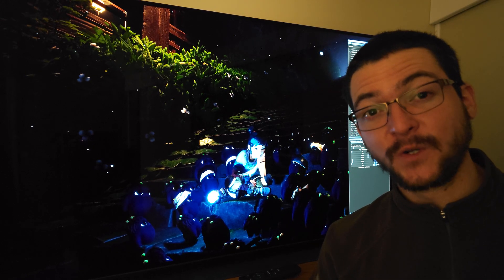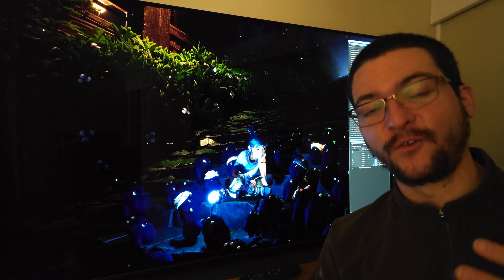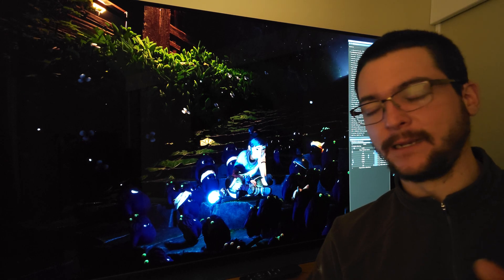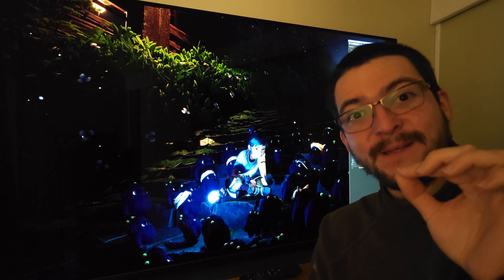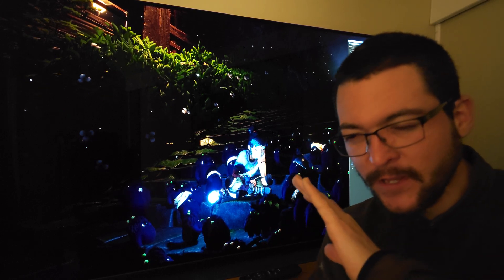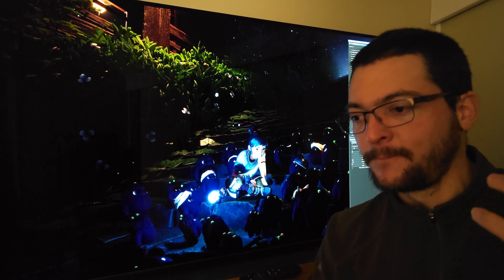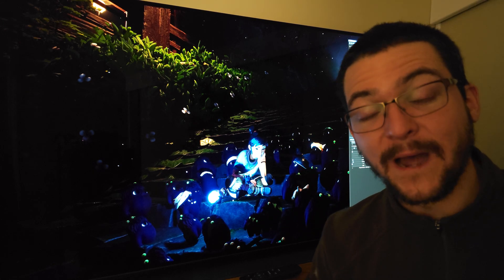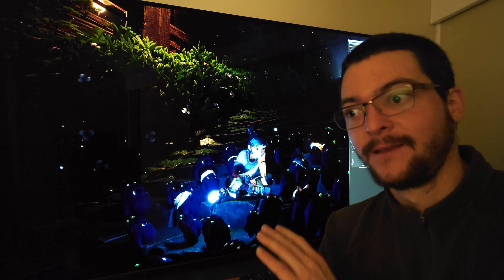What I've been using so far for OLED Motion Pro high on this LG C1 on PC is the SDR HDR trick that I shared before — link in the description. That works fantastic, it looks amazing, but sometimes near black is just barely visible. The settings are fantastic and show all the detail, but because OLED Motion Pro makes everything darker, it becomes a problem near black — just to get that perfect visibility near black without washing out the picture.